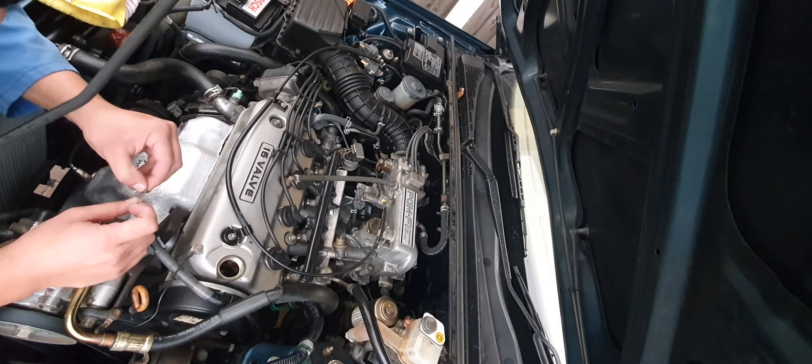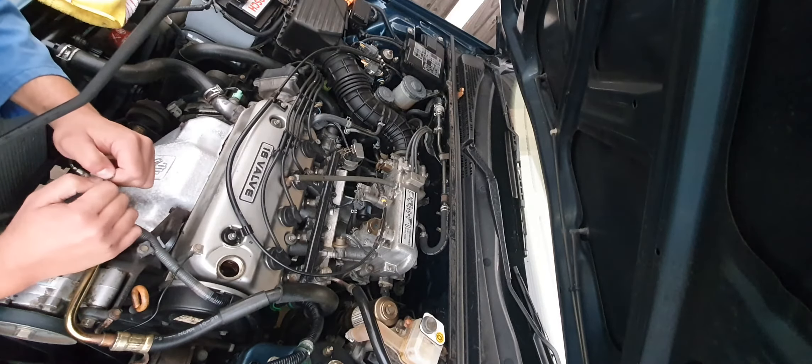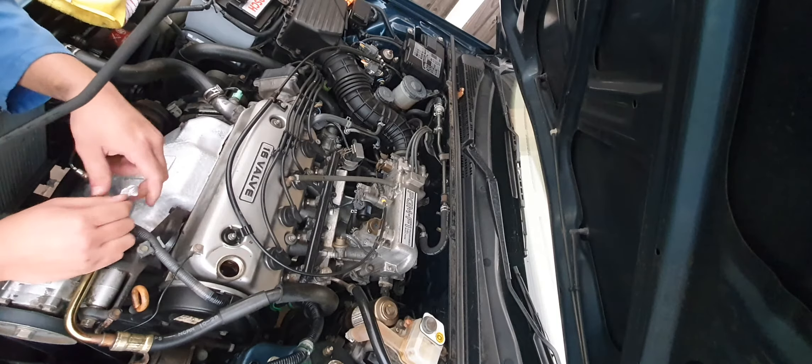Always make a point, when you top up your oil, to remove the foil completely — don't just pierce a hole in it or flap it back out of the way. Take it off completely so you don't risk anything falling in there. Luckily there was no real detrimental damage to Laura's engine. I put some flushing oil through it and did a couple of oil changes, and she ran the car for another four or five years after that. Important tip.